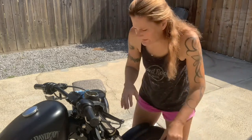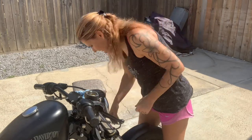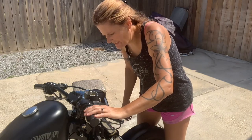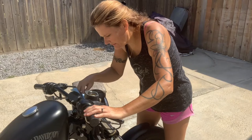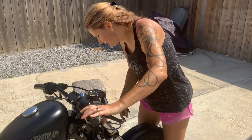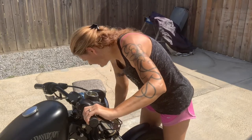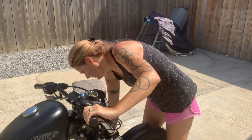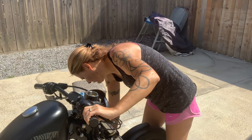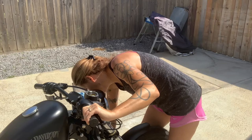We just don't want the fluid to get lower than the hole in the bottom. What we'll do is squeeze and hold, then release the brake bleeder valve just a little bit — just crack it. You'll feel it go down, then tighten it back up. That's all there is to it when you're changing your brakes.